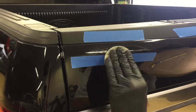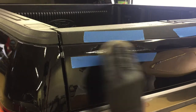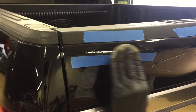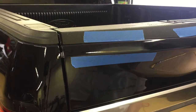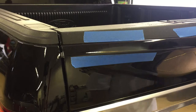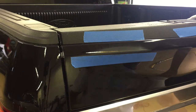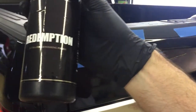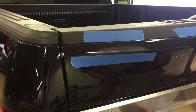Again with extremely light pressure, we're just wrapping the disc up over and around the peak to get even pressure throughout the whole area. I use this method when there's a scratch on any peak, sharp contour, or the tip of any panel or fender — taking the sandpaper disc off the block and letting it wrap around the affected area or scratched edge, trying to get the pressure evenly dispersed and not concentrated on one area, which would remove the clear and cause trouble.